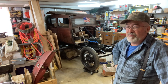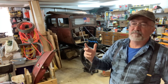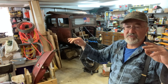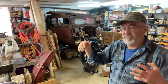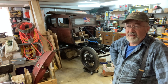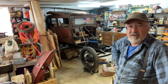That cam lobe was very rough and pitted, so I tried to sand it with emery cloth and get it as smooth as I could. To pull the camshaft out, you have to remove the timing gear attached to it, and you also have to get the lifters out — all easier on an engine stand where you can flip it upside down. The engine will last as long as it's going to last. I'm not even sure if it's the original cam from 1929, as my dad couldn't really remember what was done during the 1962 rebuild.